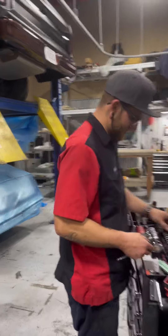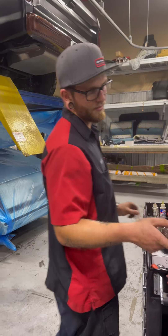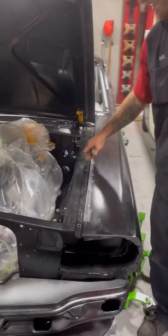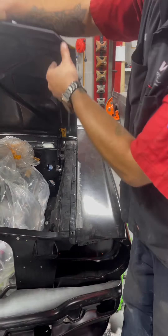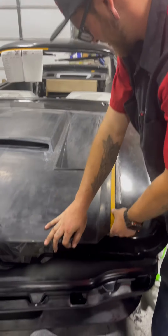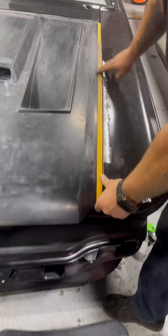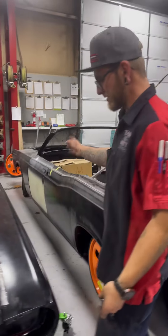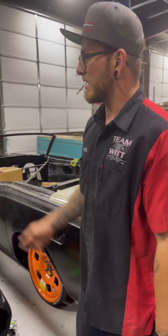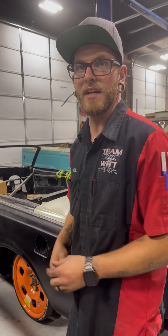What are you working on? Getting ready to pull the front fender off of the Mustang so I can be welding it. I had to split it and re-arch the fender so that it matches the new hood. This is the '65, right? Yeah. That way it matches the new hood, and then once I get it fully welded I can clean it up and we can actually cut back the hood and gap it. Nice.